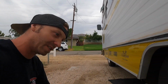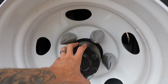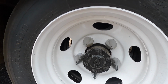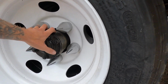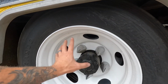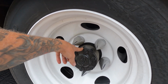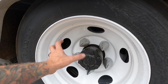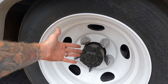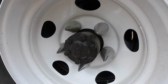I'm really just hoping for a broke axle because this is a full floater. So what you do is you pull this out, and then this slides out. This is actually your axle. I don't even have to take off a tire to fix that because this is on a separate hub, and they do that on heavier weight stuff. It's stronger because the hub itself has bearings, and then the axle on the inside has bearings. So the outer bearing is not supporting the load of the vehicle, right? And the axle at the same time. Like on a standard one, your axle actually has a bearing on the axle, where this axle is just taking the twist load versus the weight and twist load. So that's what makes these stronger and better. And when they break, it's all contained, and your wheel doesn't want to slide out depending on what kind of rear end you have. So this gives me hope.